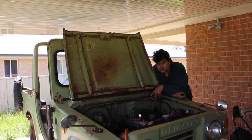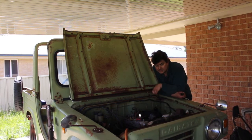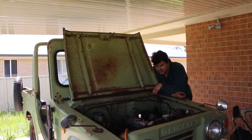It needs a water pump bearing as well, so I'll do that too while it's apart. It's probably a stuck valve or it could even have a stuck ring — it does blow a bit when you're cranking it and it's trying to start out of the rocker cover breather. It could be down on compression on one cylinder and just doesn't want to start. The ballast resistor on the coil is wrong too — I've just been too lazy to change it, so I've been bridging that together, meaning the points have just been seeing fourteen and a half volts straight out of that coil the entire time, so they're no doubt burning up.